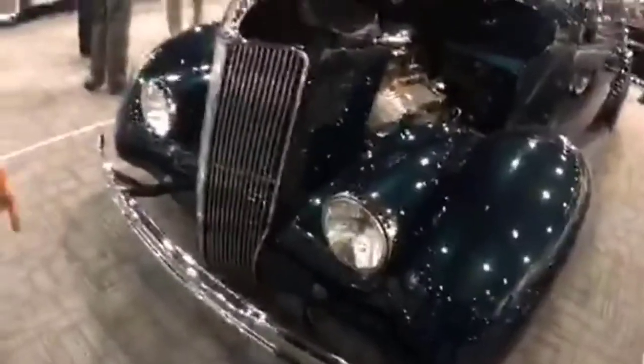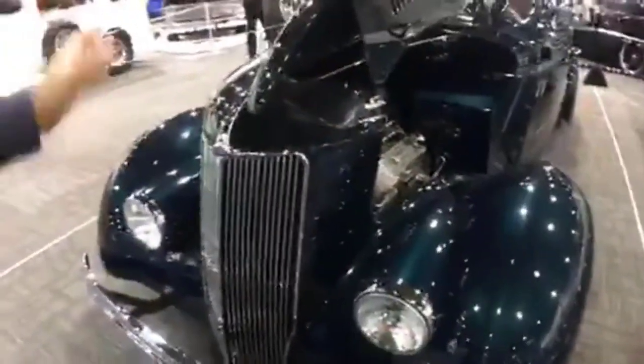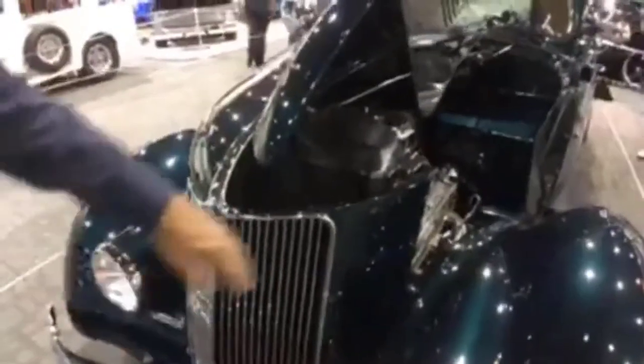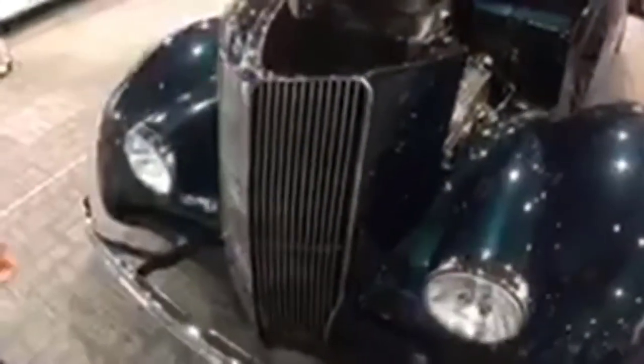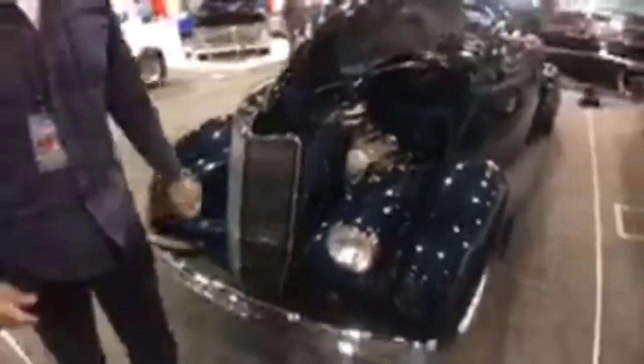Have you driven this thing at all? Only in the parking lot here, around the house a little bit. So let's show them the front — those aren't stock '36 headlights, that's for damn sure. No. I took a cue from the Calari Coupe and those are '40 Chevy headlights, Pomona swap meet find. And the grill — I didn't know what to do and everybody's done LaSalle grills. So what I did is I went on Photoshop and I got a nice picture of the front end of the '36, and started reducing the amount of bars. There's normally 17 bars across each side — we got 12. And it kind of sort of looks like a LaSalle, but then you see it's a narrowed '36.